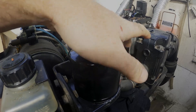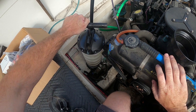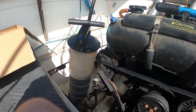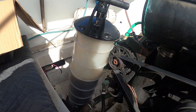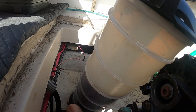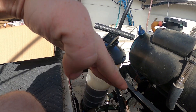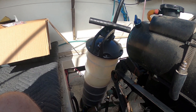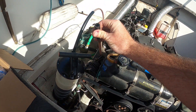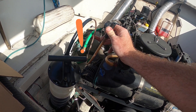You know the filter is tight once the gasket has seated plus half to three-quarters of a turn. Coming back to the oil pump, I'll pump it up again — this is the noise you'll hear when the oil is totally empty. Based on the rungs we can see one, two, three, four quarts. This is normally a five-quart engine, but depending on how the engine tilts you can have a four-quart system.